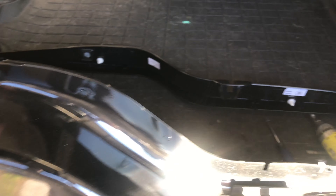For the next side, we're going to remove the subwoofer that goes right here. Remove those bolts and lift it out. There are two connectors, one on each side right here and right here. Then your other actuator is right there. This really gives good access to this one, so this one should be much easier than the last.